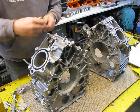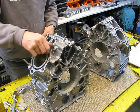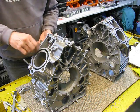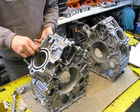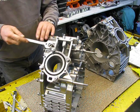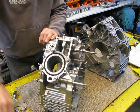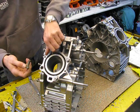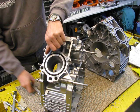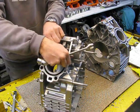I have made special short bolts, and still sand is coming in. Look, there's a lot of dust and dirt going in the thread, and I want to have that clean. What I have done is I used the cylinder head bolts, I have plenty of them. Cut them off and welded a nut on them so I can tie them up and remove them easily. A little bit too short, so maybe I have to look how much sand is coming out there. And now I know this thread will be a problem, because there is sand in it, or dust, debris, whatever you like to call it.